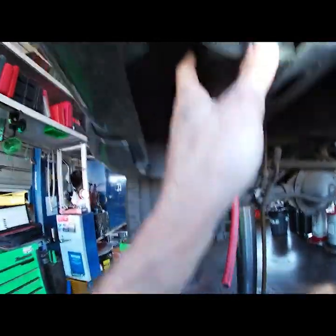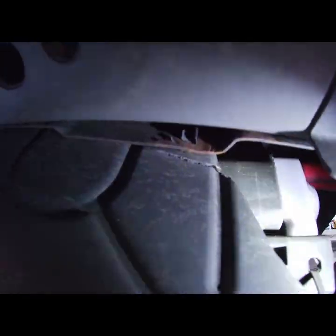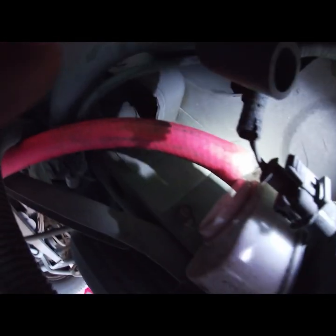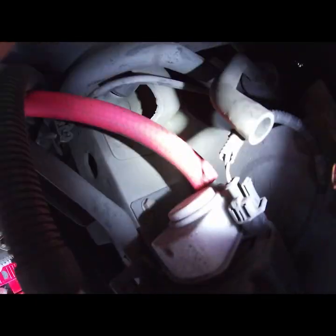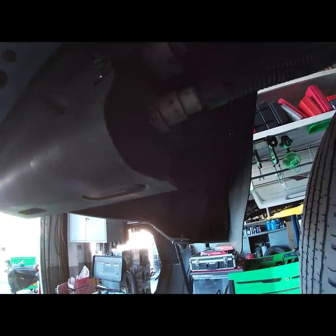So the spare tire area — huge canister, nice and loose, hanging on by one zip tie up there. There's literally that's all holding it in. This is cracked, so this is good that I'm verifying the repair and that it's the only fault. Here's the ESM valve — ESM switch valve, two wire switch. Take off the vent that goes to the filter. I'm blowing this hose and this PID should change from open to close. I saw a bunch of air coming out of here so I wouldn't be surprised if there's another leak, but the valve is working — open to close.